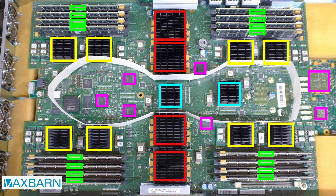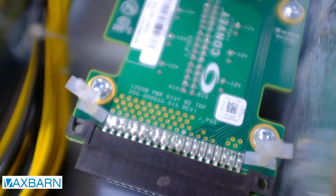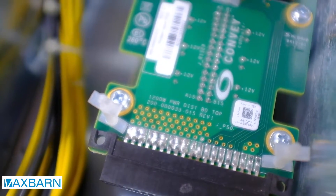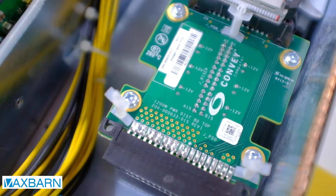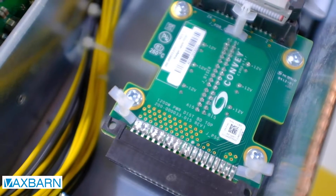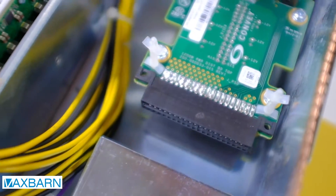Finally, there are some more FPGAs scattered over the two boards to provide management capabilities, glue logic, and of course the PCIe interface to the host system. In all, there are close to 40 FPGAs in this box. There's also a PowerPC microprocessor on the big board. The PowerPC processor provides a management interface to the system and is responsible for loading the configuration bitstreams into the various FPGAs, monitoring the power supplies and fans, and running various diagnostics on the system. The missing power supplies are a bit of a challenge, but by measuring the size of the power supply slots, counting the number of contacts on the connectors, and determining which contacts are connected to ground and plus 12 volt buses, I believe I was able to identify Supermicro power supplies that should work in this system.